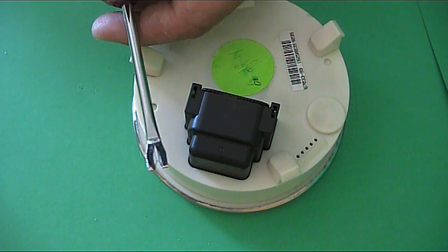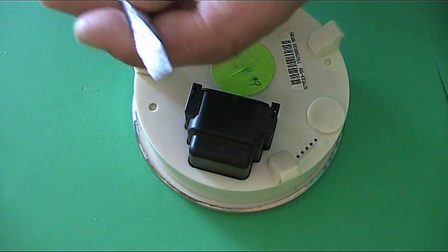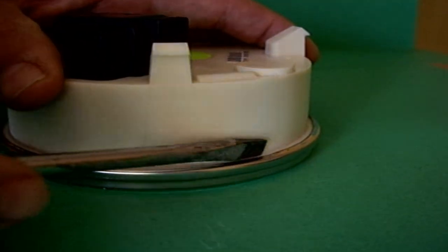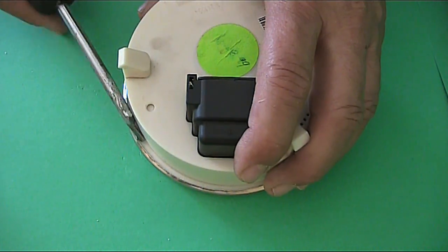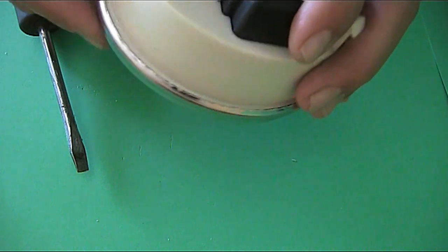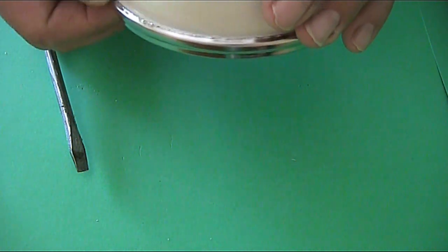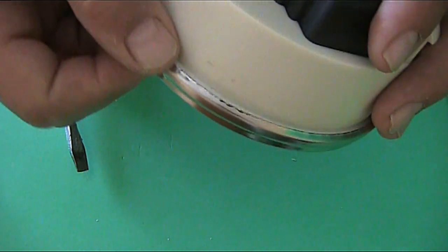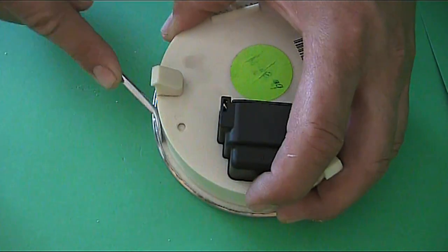If you don't have these tools from the Chinese import outlet, you can use a flathead screwdriver, but I don't recommend it. The problem is that because of its angle, it tends to slip. Every time it slips it sort of cuts the bezel a little bit and lifts it up in that particular spot. Once you try to seal the bezel again, that little slip or crack is going to stand out proud. So I've discarded the flathead screwdriver in favor of a nail puller of this sort.